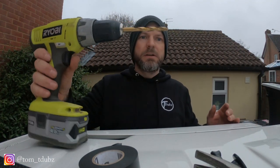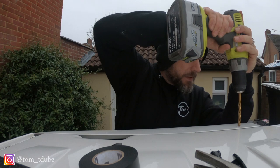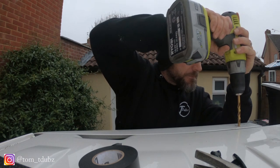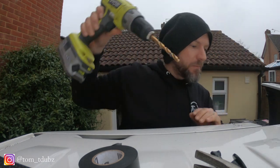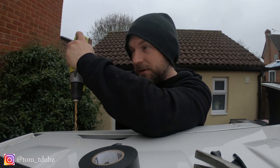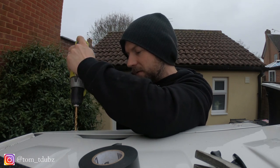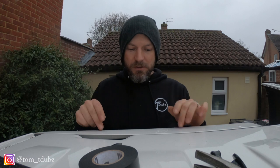I've pre-drilled the three mil holes and now I'm on to the 8.5s — 8.5s work really well. Going through slowly but not going through the van; this one is just through one skin so I need to be careful not to push too hard. There we go, that's free. Okay, let's go back inside the van, sort the spoiler out and get her in place.